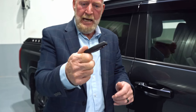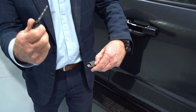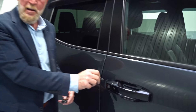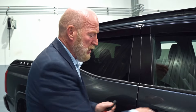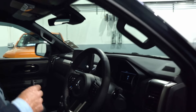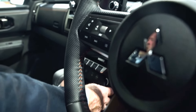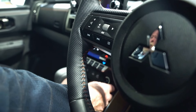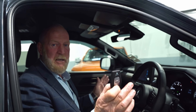If you look at the key, there's a little slot — you pull that back and the key comes out. You unlock the door manually, make sure you put the key back in, and when you jump into the vehicle to start it up: foot on the brake, hold the fob over the start button, push start — it'll still recognize the key to this vehicle and start it up, so you won't be stranded.